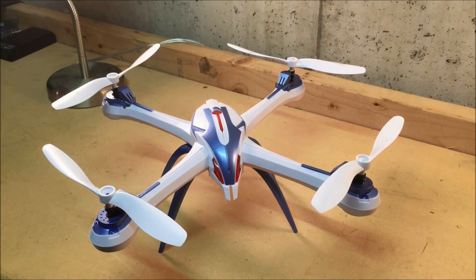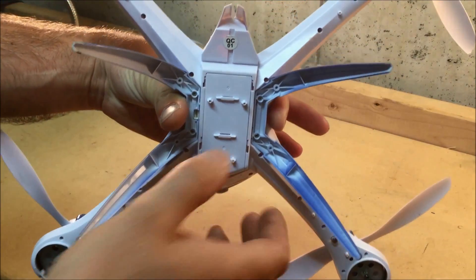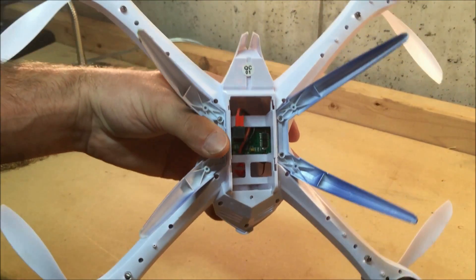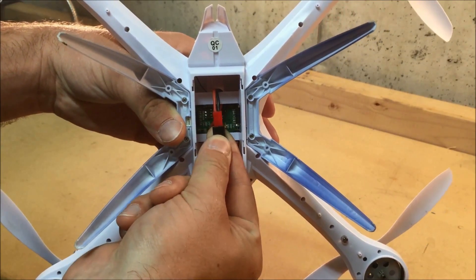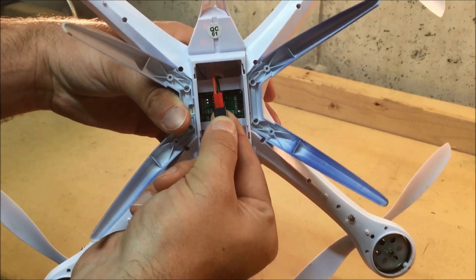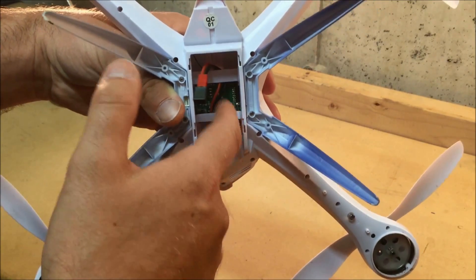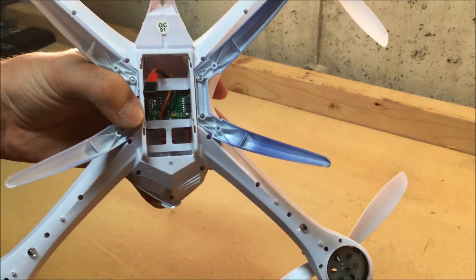Now that you have everything you need, we'll start by prepping the quadcopter. You're going to take the quadcopter and pull the battery bay completely off of it — you're not going to need the battery bay anymore. Once the battery door is off, you'll notice that your battery wire comes out towards the middle and can't stretch any further than the middle of the battery bay. This is fine if you don't mind monkeying your fingers in there to plug it in, and it still allows you to use the stock battery bay configuration if you're flying without a camera.